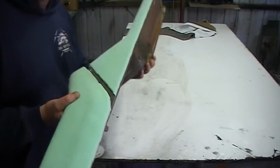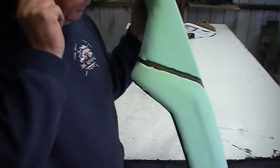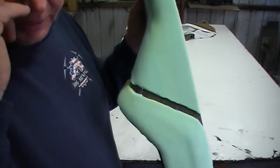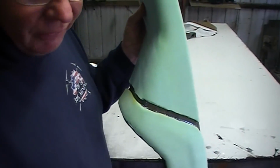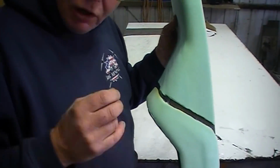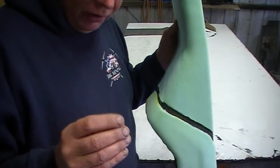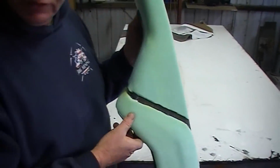Loaded that glue right up, okay? It's a technique, it's not an accident. With contact adhesive, especially rubber-based contact adhesives for upholstery, you can buy them in spray cans at Bunnings and whatnot. Don't be afraid to load it right up, but let it dry right off, okay? Let it go so it's touch dry. And then it'll give you a really good bond.